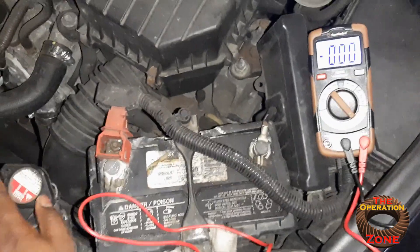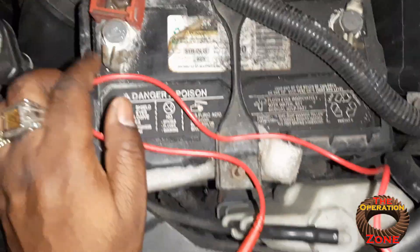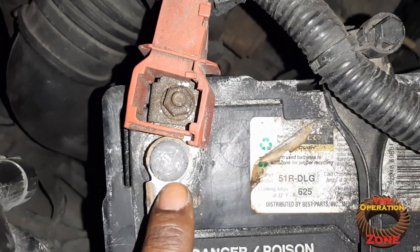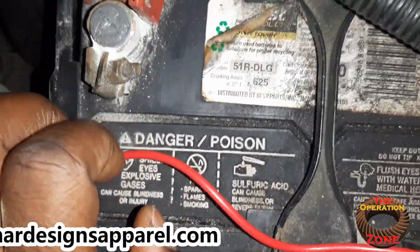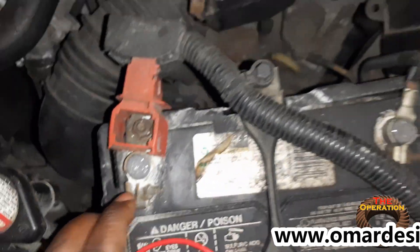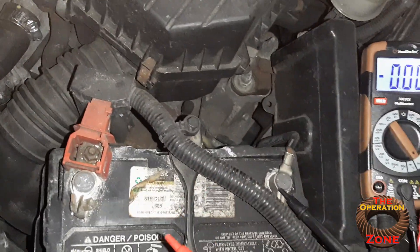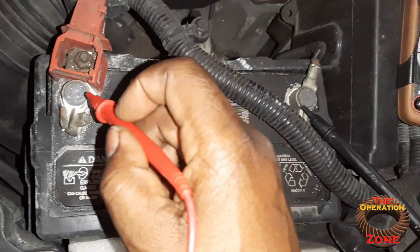I'm here at the hood and just as soon as I opened it I could tell what the obvious problem was going to be. Upon opening the hood, I can look at the positive terminal right here — the one that's normally red, the plus on the battery. The positive terminal is really corroded. It has a nasty corrosion. This is actually after I brushed off a little before I turned on the camera. This can be a part of the problem. I want to read the voltage and charge on the battery and see what the deal is.